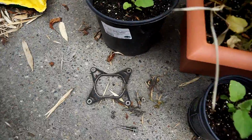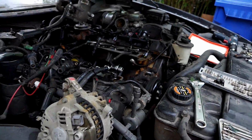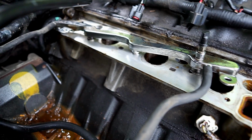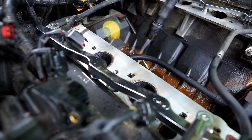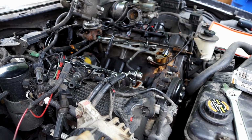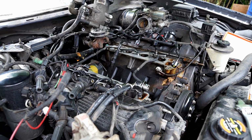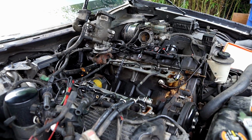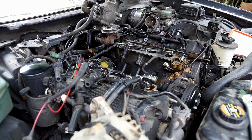Where did I put it? Over here. Leave off that gasket and just go with those O-rings. So that's what I'm going to do. I cleaned those off. I'll go over it one more time, and then I'll start putting the new one in. I'll be shocked if I don't have some bolts left over, but I'll do my best. As long as I get good seals, get the electrics and the fuel hooked up properly, that's the main thing. We'll see.